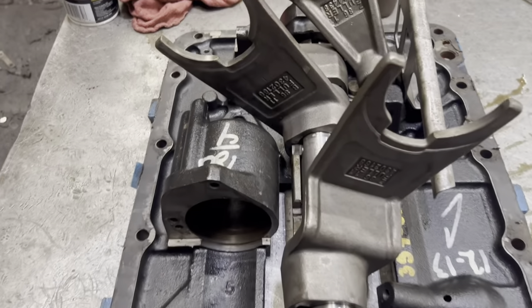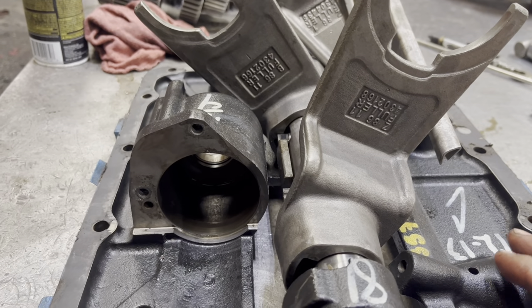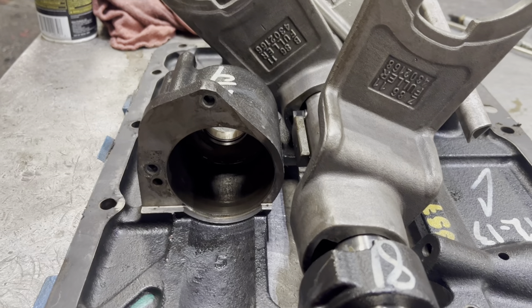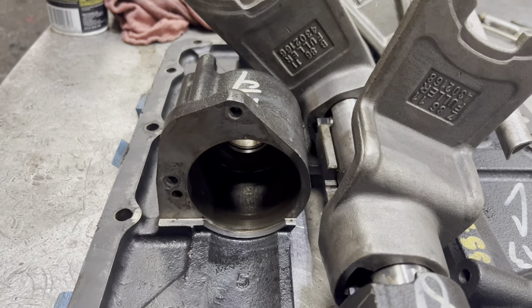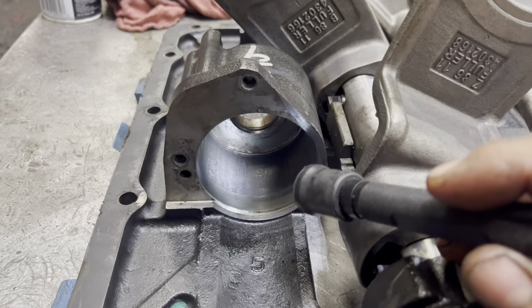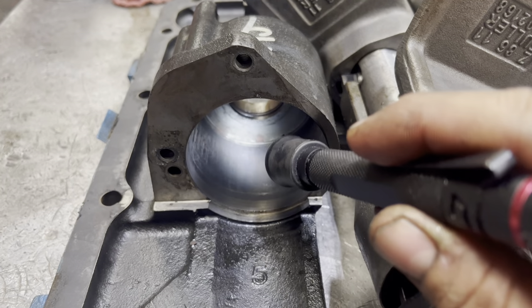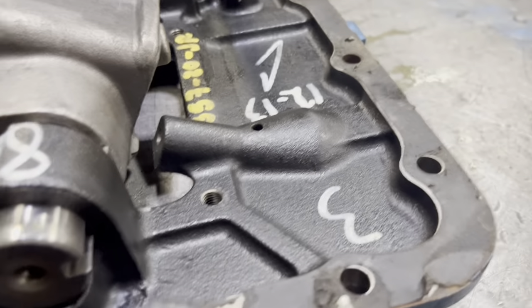Let me explain this a little bit better. This is a top plate that came out of a customer's truck. We had built this transmission last year around September. This guy had a complete air system meltdown. This thing was full of about five gallons of water, which, as you can see here, is what water does when introduced into the air system. It makes its way to the top and starts creating these little vertical gouges when rust starts scrubbing back and forth in there, and air bypasses this piston.